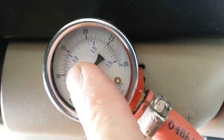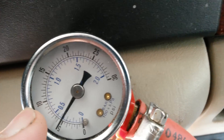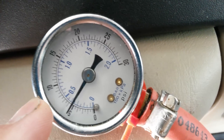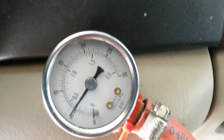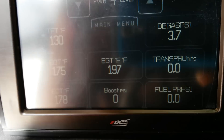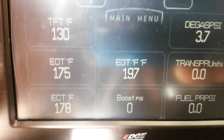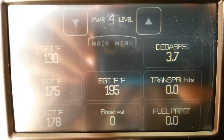You should not see more than 10 psi under normal operating conditions — anywhere from 180 to about 205-210 degrees, you're not going to see over 10 psi, unless you're running your cooling system way high. Normal operating is going to be between 5 and 10 psi. When you're starting up your truck every morning, it's good to let it come up to 5 psi. Right when it gets to about 185, you're going to be almost at 5 psi, and that's right when I'll start moving the vehicle — I do that to baby my engine.